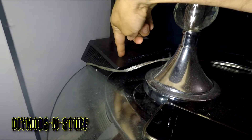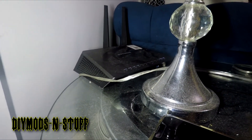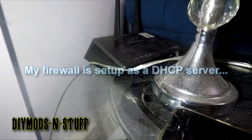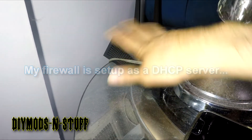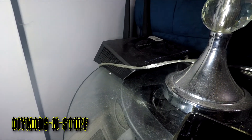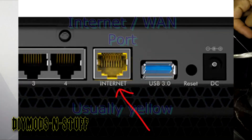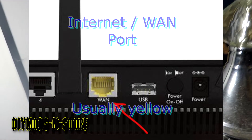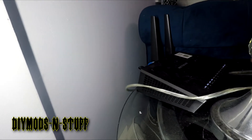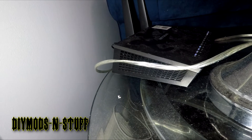You can plug directly to your router — any of the supported routers. I didn't have to reconfigure the router at all. All I had to do was reboot the firewall so it could get a new IP address. Otherwise, just reboot your router when you switch from Optimum, Spectrum, Comcast, or whatever. Once they set everything up, turn off your router, plug it into where the blue cable is — if you don't have a firewall — power it on and you're set. Your network stays the same but now you'll have higher speeds depending on your plan.